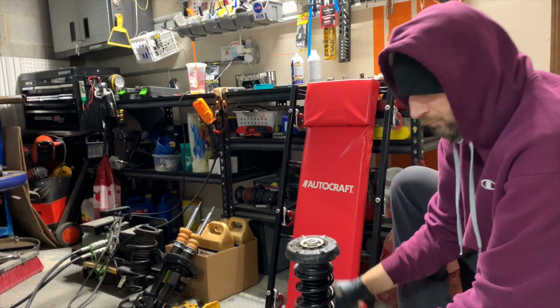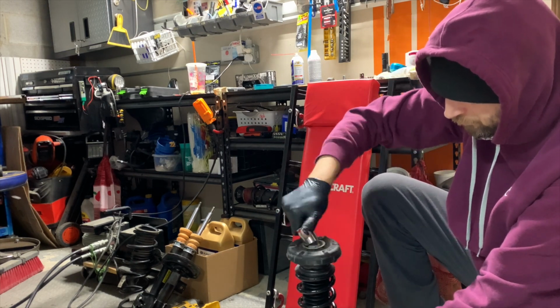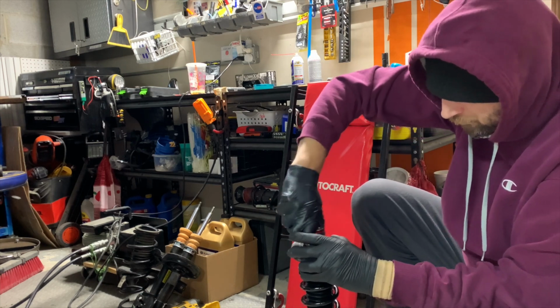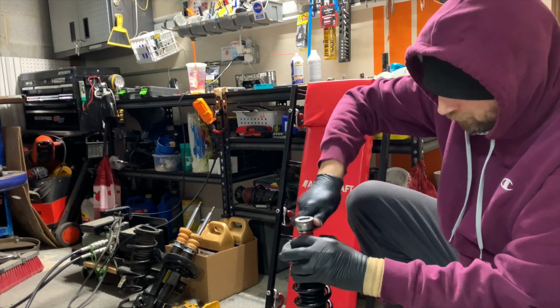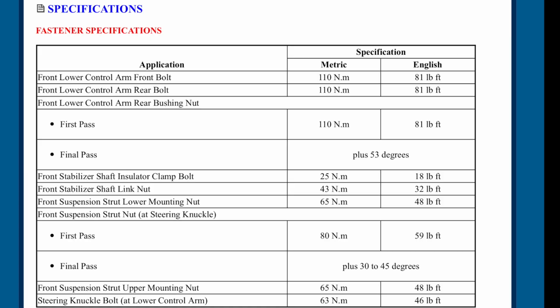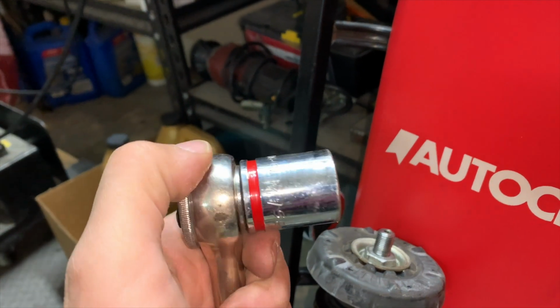A 24mm deep socket attaches the top mount to the strut. To tighten it fully, you can just hold the top of the mount, the rubber part, and tighten the rest down, and it'll tighten completely without spinning. Recently I subscribed to an online repair manual for the Spark EV, which is just wonderful, and it says that the strut lower mounting nut is 48 foot-pounds. Just for a visual reference, you should have this amount of strut sticking out from the perch.